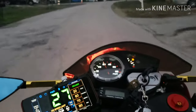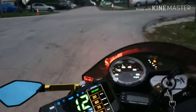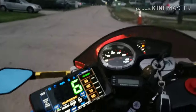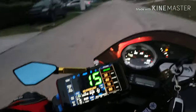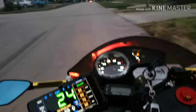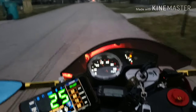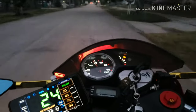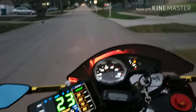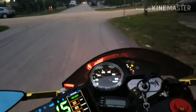I got more speed and more RPM without changing the roller at first. Pretty much the first thing I did was change my carburetor and take it for a test ride, just to tune it - not too rich or lean - and that thing was making my RPMs higher, like close to 9,000. So I'm like, okay, let me put heavier rollers in. Right now I have 7 and 8 gram rollers to make it 7.5 grams average, and that's how I got my results getting like 46.